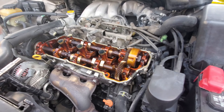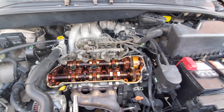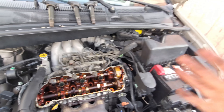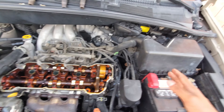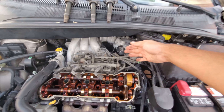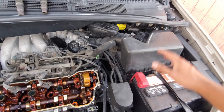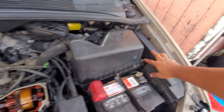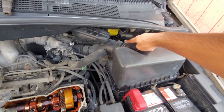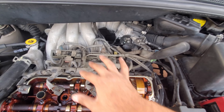And that's how it looks from the inside right there. Now we have to start removing all this stuff right here to start removing the intake. In order to get to the rear valve cover, we need to remove the intake. So we're going to start by removing the air box, which is pretty easy — it's just clips, a hose with a clamp, another hose with a clamp.